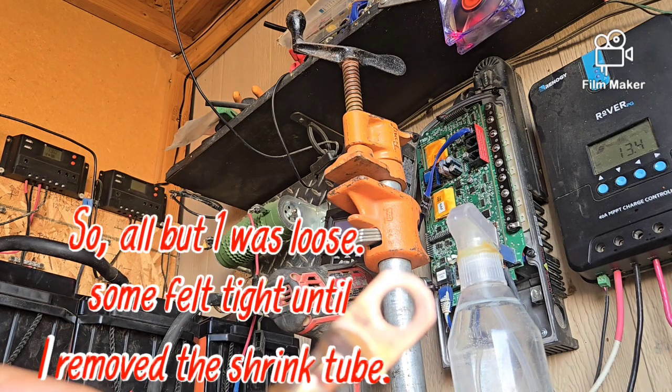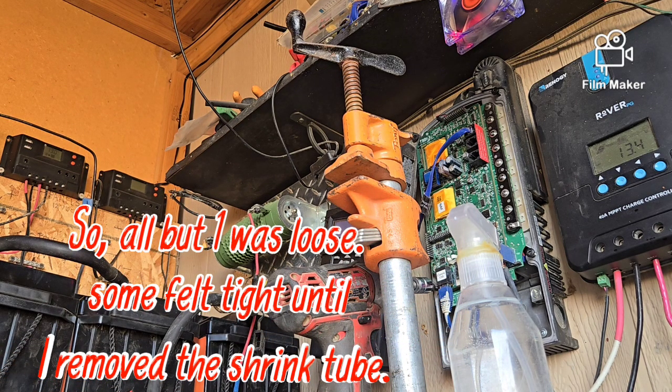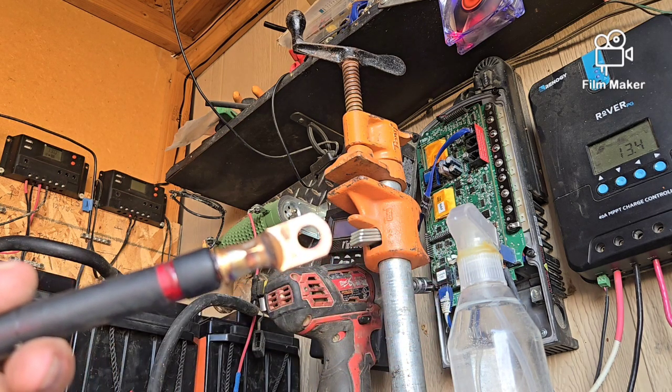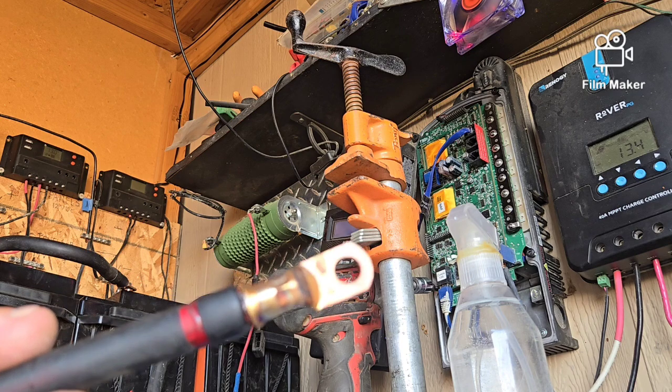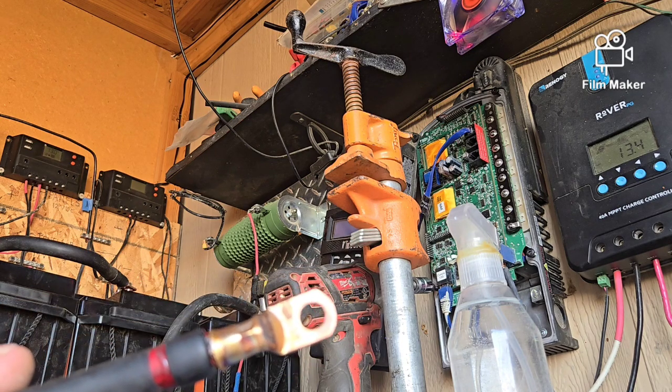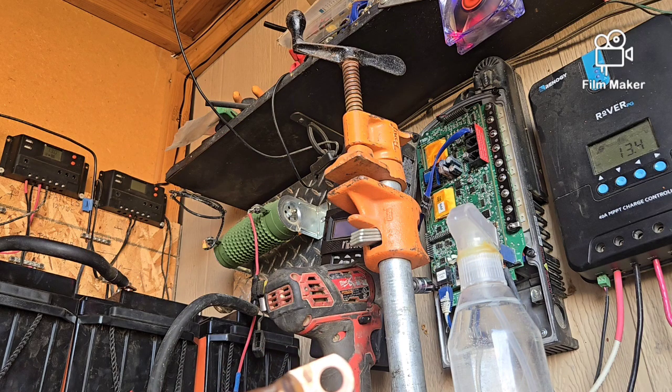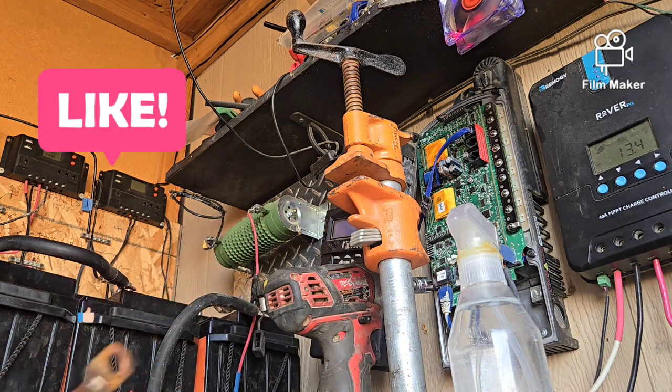The other thing I noticed was wrong — to the individual who did these — is the location of your crimp. You crimped them too close to the eyelet; you need to crimp them back closer to the flare if you're going to use a crimp. I've never liked crimps — I've even got a hydraulic crimper for doing that, but crimps just squeeze two pieces together and don't give you a super great contact. There's nothing like a good solder.